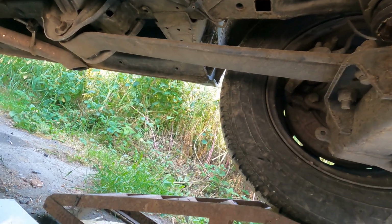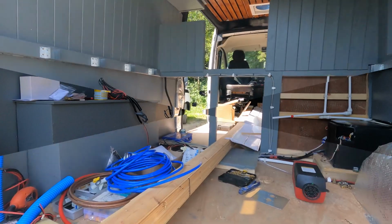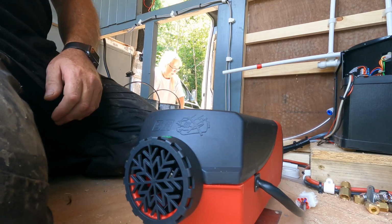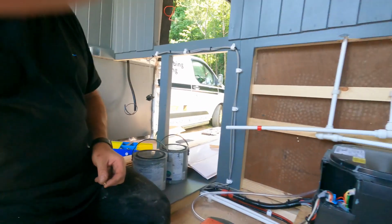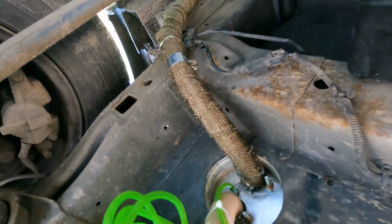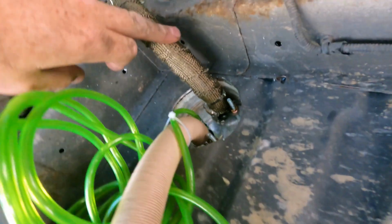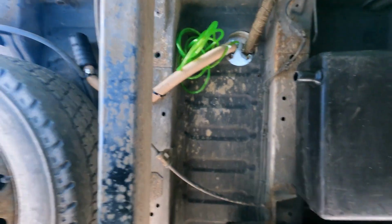Anyhow, diesel heater. Let's get the pipes hanging through the floor, shall we? Everything connected up, basically. Right then. It's my tool bag. Don't lose it. Right, I was thinking, though. The camera's on its side. So what I've done is I've run that waste out there, that bad gas is out there, it's all clipped, supported. Nothing flammable. That is a cable, but there's a shield on it, so it's okay. And now I'm starting on the fuel pump. I'm going to put you down here.